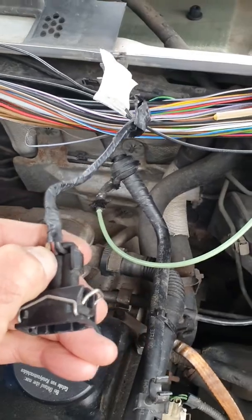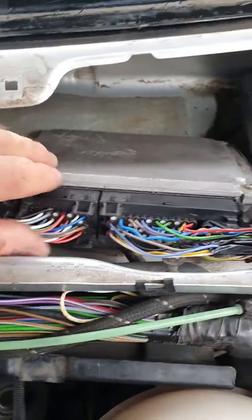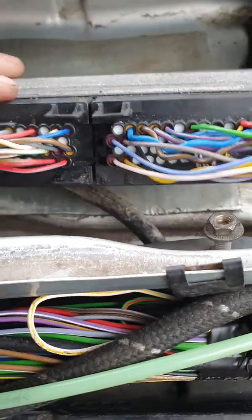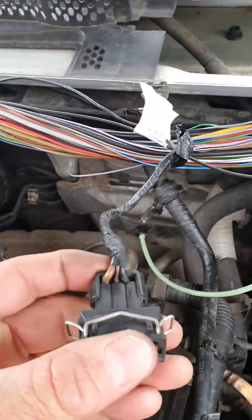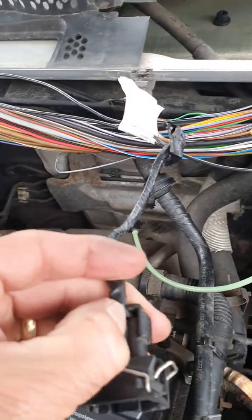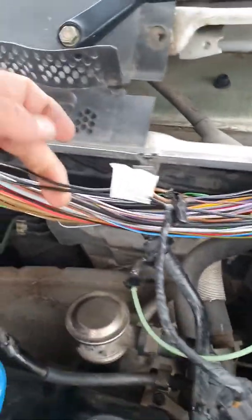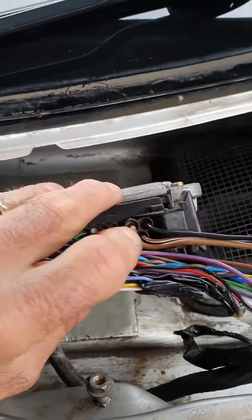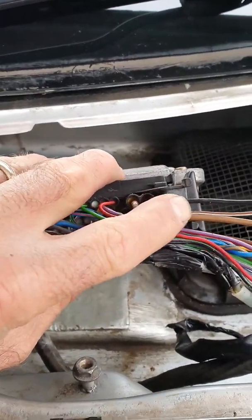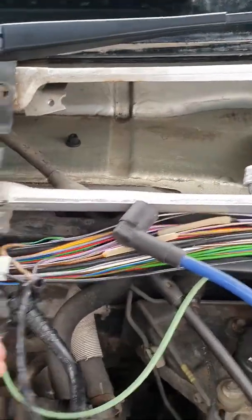Your black and red is a feed from your ECU - the ECU controls the output on this plug, I think it's pin 74, and that feeds out to your coil once the ECU gets a good circuit. Your black here is a permanent 12 volt feed, and that's shared with your permanent 12 volt feed to your ECU connector at the top. When I connected VagCom it was saying no ECU, and that's because the voltages to both of these lines had died.